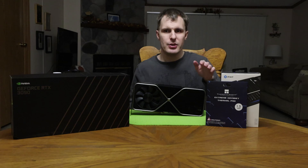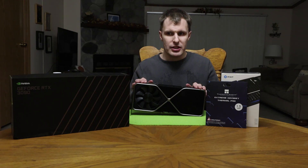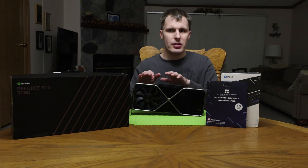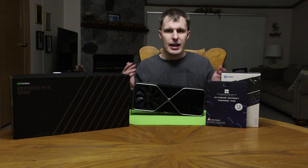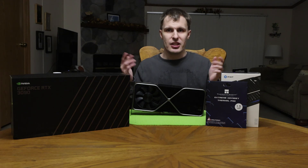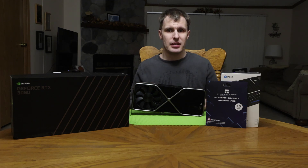So today we're going to use these ThermalRite thermal pads, 1.5 millimeter thick, 12.8 watt per meter Kelvin thermal dissipation, and take this apart to hopefully improve our temperatures by a bit. We're using an iFixit kit for all of our screwdriving, and some alcohol just to clean up any old thermal paste left over. None of these are sponsored products in this video, but they are definitely useful to have. So, let's begin.